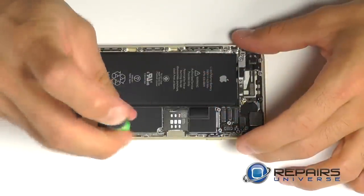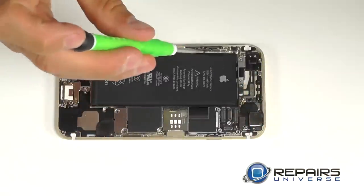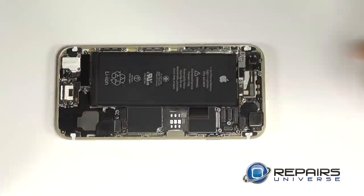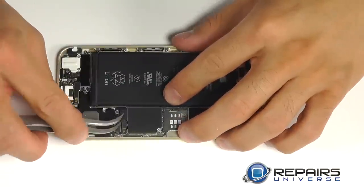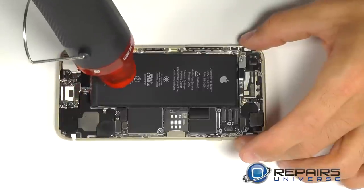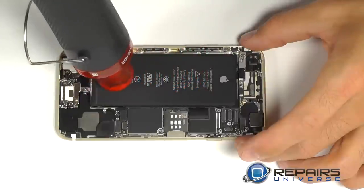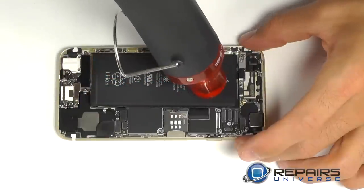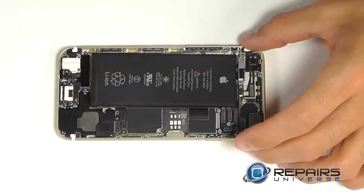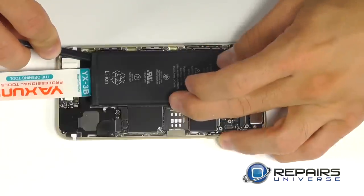Let's now bring our attention back to the phone, starting with the removal of our battery — the two Phillips screws securing the cover plate for the battery's connection. We're then going to use our tweezers to release the connection. Originally the battery was equipped with pull tabs towards the bottom. Because we've previously removed our pull tabs and reinstalled the battery with adhesive strips, we are going to heat up the adhesive with a heat gun or blow dryer and then use a pry tool or the flat side of our spudger to get under the battery and peel it up from the iPhone.